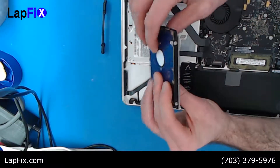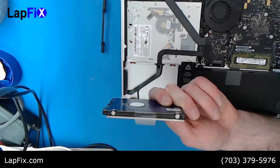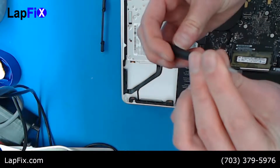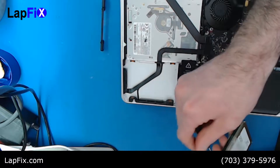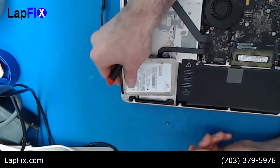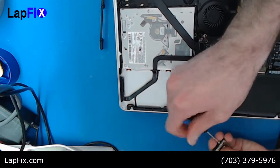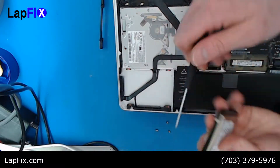Attached to the drive you'll see four silver screws — you'll need a special star-head (Torx) screwdriver for these. It looks like a star with six little points. These screws hold a bracket that sits on top of the hard drive. You'll also notice little orange pegs that help hold the hard drive in place. Realistically you can use just two, but it's always recommended to use more since the hard drive is a very important part.